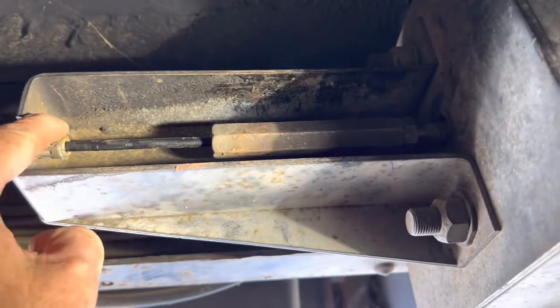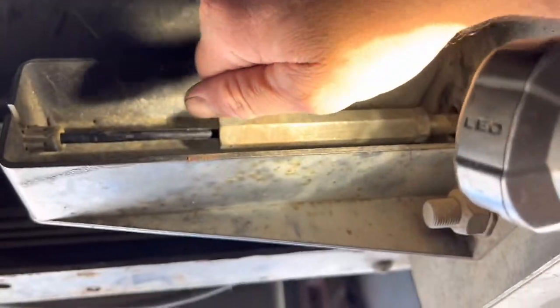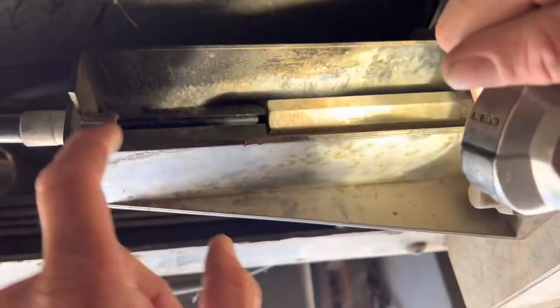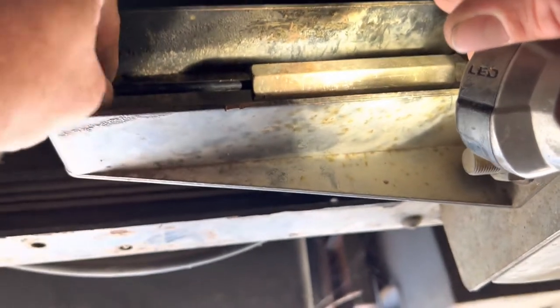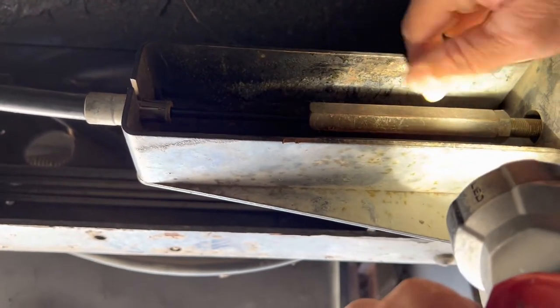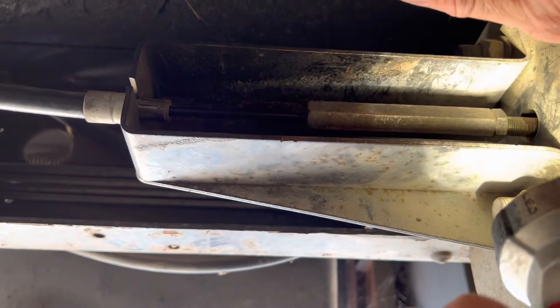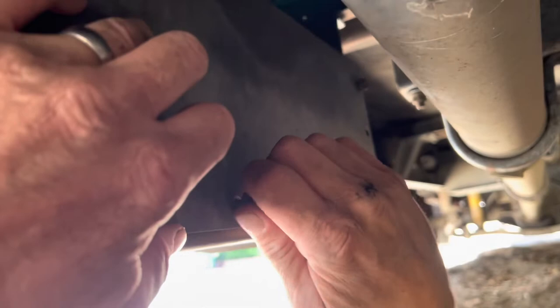Now back to the cable — it's going to be pinned up over here still. What I had to do is grab this bolt with a pair of vice grips or channel locks and pull it as far this way as you can, then pinch this part with vice grips and let it go so it wouldn't move back. Then you work your threads back onto this threaded rod and tighten it until it's completely tight, put your lock nut back, and it won't move anymore. After you replace the green switch, go ahead and close this back up with the six bolts you took out, then go up and test it — and that should be all there is to it.